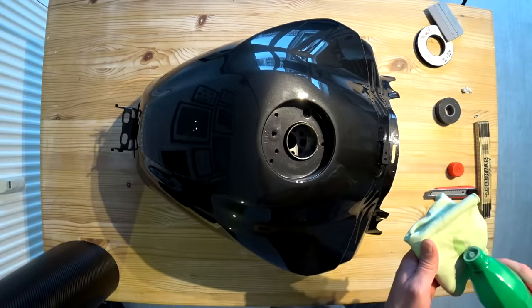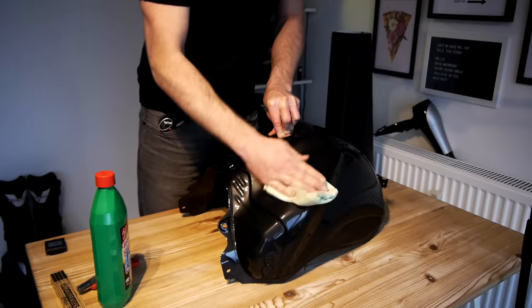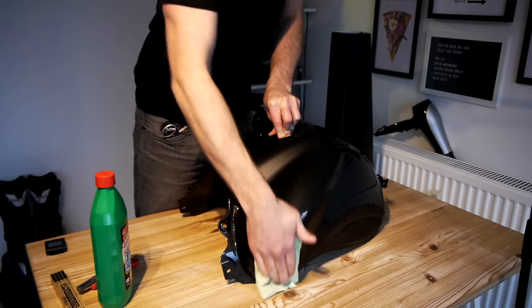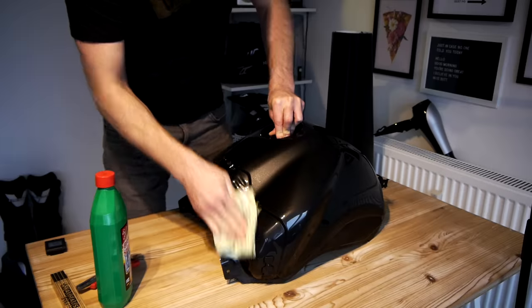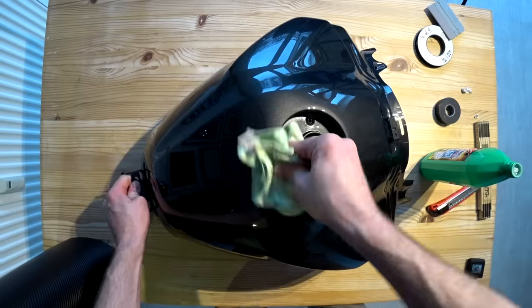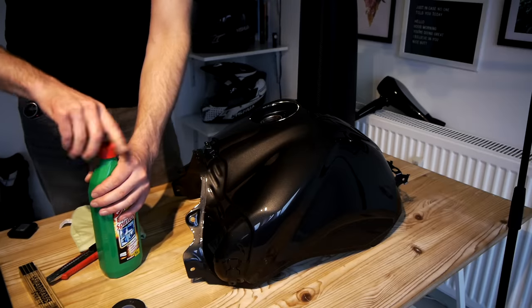So now our tank is mostly clear of all stickers, but we need to do another stage of cleaning to get rid of this horrendous sticky residue and also any grease, sap, road tar, wax residues, or anything — because any kind of wax coating on the paintwork will actually cause the vinyl not to stick as well. This is where the alcohol comes into play. Put a healthy dose onto my microfiber cloth — just doing a lovely job of taking off that glue there. Smells like tequila. Give the whole thing a nice good solid rubbing, paying special attention to your grooves, cracks, and holes.